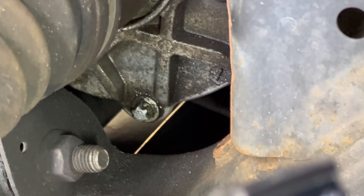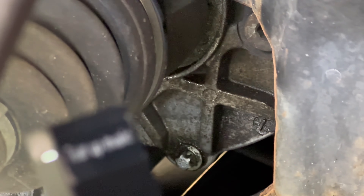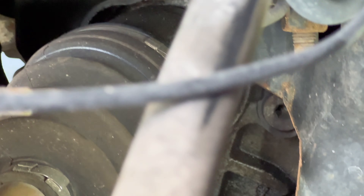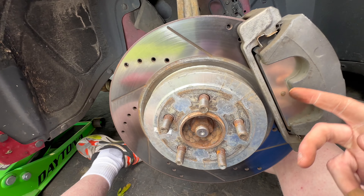Trying to focus in with the flashlight — you guys can see all that liquid right there. We're removing this because it should not be like that. The boot is in fine condition, but all that liquid is dripping. I'm pretty sure it's from the seal, which is right behind the axle. The boot's in okay condition, no problems. This is a new CV so nothing's leaking from there. You can see it's all coated over there — that's leaking from the seal. The drain plug is tight, so it's not that.